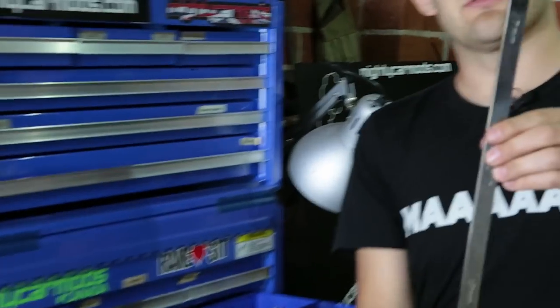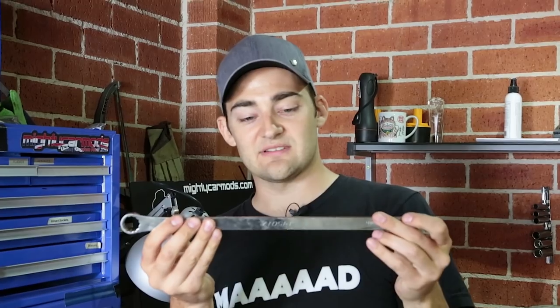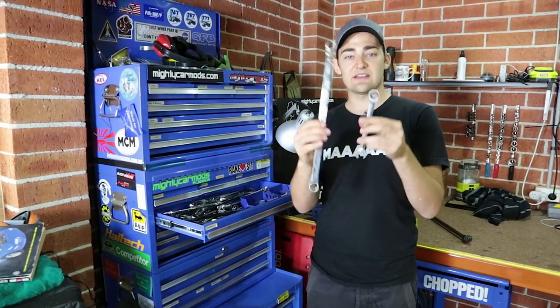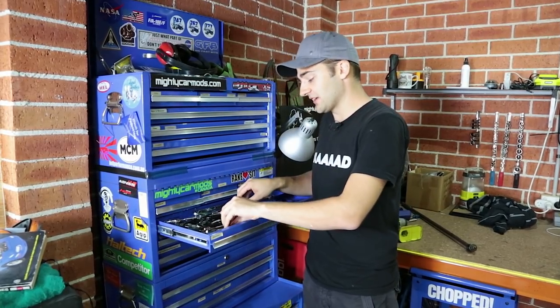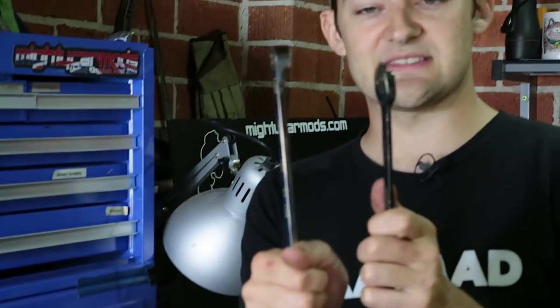These are the best ever when it comes to spanners — nice and long so you can get a lot of torque on them, with two different sizes on each end. People would have seen a lot of them on Mighty Mods over the years, for cracking suspension bolts: 17 on one end, 19 on the other. Things like that have just come in so handy. If you're only ever going to have two types of spanners, that's generally what we go to almost all the time. It's also good to have two of each size because when doing suspension bolts, you'll need to hold the top of the nut still while you do the bolt on the other side.